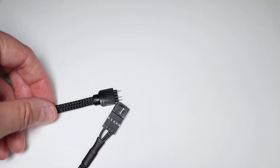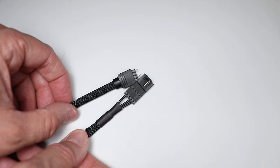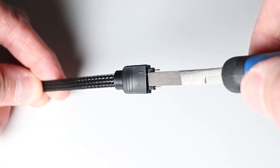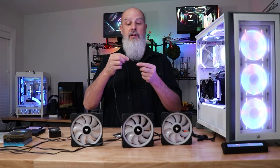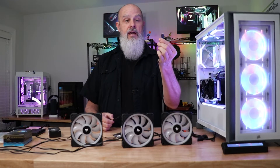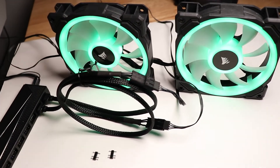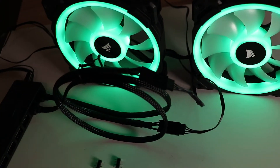I found some on Amazon. They weren't really cheap — about $10 a piece — but it's a pretty lengthy cable, and it's built better than I can build it even after learning how to crimp. It comes with a male connector on the end with an adapter you can remove. Just plug your 4-pin Corsair fan into it and it gives you the 3-pin ARGB connector on the other end, male or female. You can go into a controller or directly to your motherboard — anything using 5-volt ARGB connections, you can then get control of your Corsair fan.